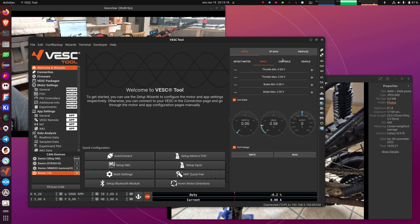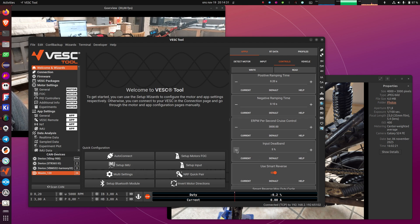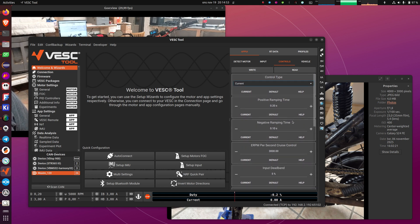The next step is Controls. I will set this to the VESC remote app and set it to current control. I'll reduce the ramping time a bit because I want my throttle to be responsive. I'll reduce the input deadband to 5% because I don't want a big section that is not giving any throttle. I will disable Smart Reverse — it can actually be useful in a bike if you have a brake, but there is also a reverse function with the display, and I'll use that instead. I'll write. Sometimes when you have real-time data polling and you're connected over Wi-Fi the packet might get lost — I'll try again. Now we got app config write.